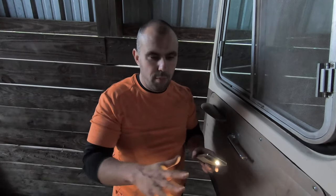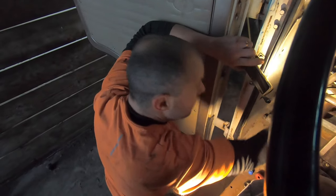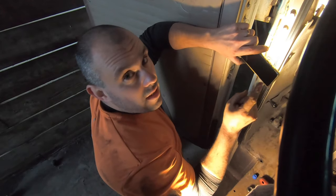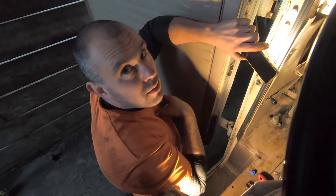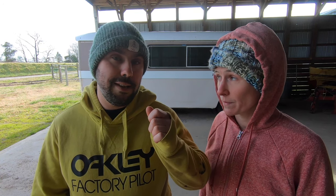We just need to slowly pump the pedal a couple of times until it goes firm. Need to connect the clutch line to the master cylinder and then check the level, and then we can start bleeding the system through. And then when we tried to bleed the system, it leaked between the master cylinder and the fitting, so we decided to replace that.